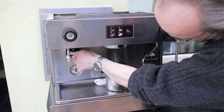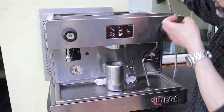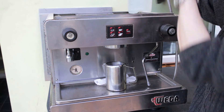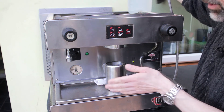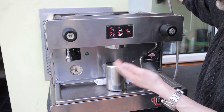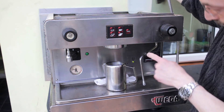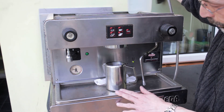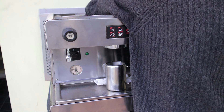Unfortunately I can't test whether position one actually fills the boiler, since that must be down to line pressure. The only other way to test it would be to fit a nozzle so I could invert the jug and have gravity push water down to fill the boiler — I might try to rig something up. I also need to read the manual, which I managed to find and download for a very similar machine. The Wega machines are all kind of similar. I need to check whether that indicator light should be on or off. We know the boiler is not heating up, which I was told anyway.